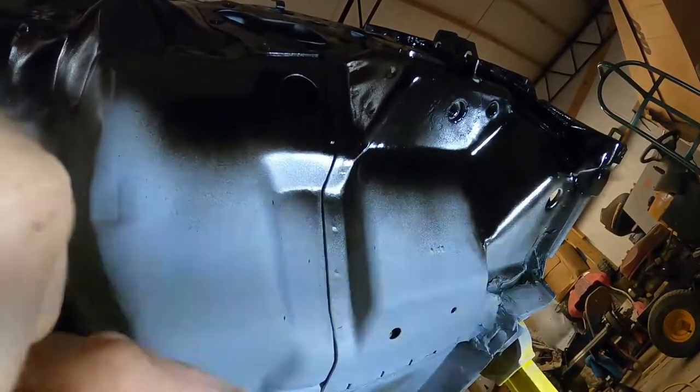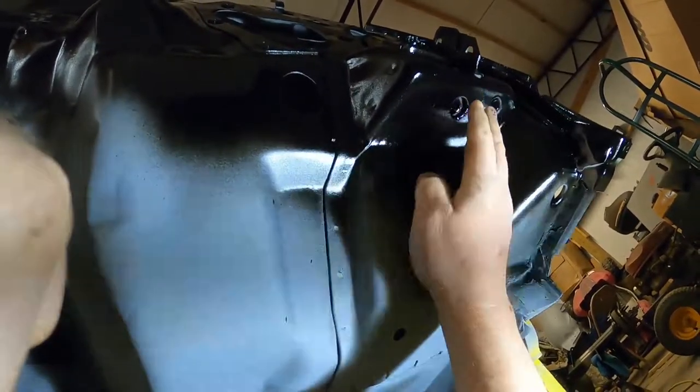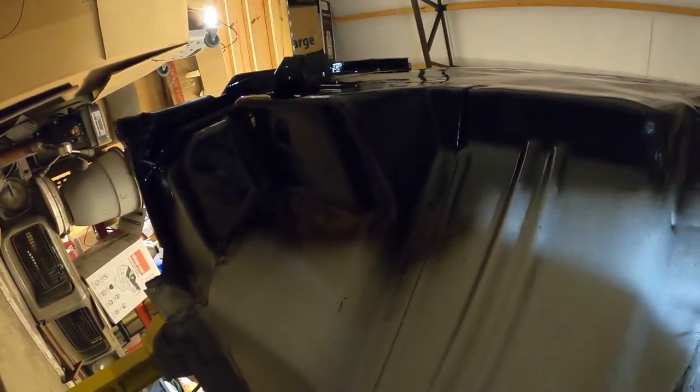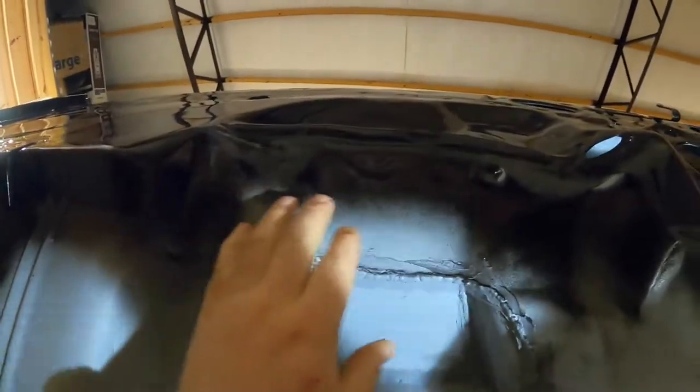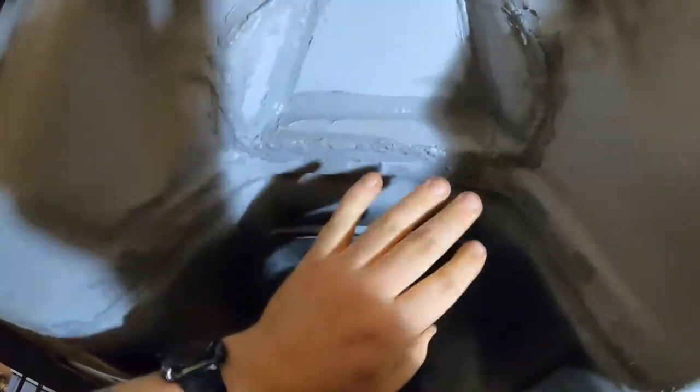As you can see where the body bolts up here, I have this area painted and clear coated. Somewhere along in this area is where my Raptor liner line will be. In this area I seam sealed these seams, but I have to spray some primer on it — I'll wait until I get my firewall taped off.